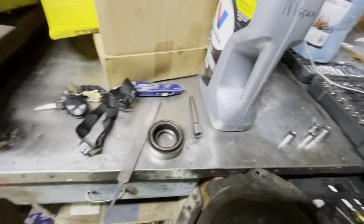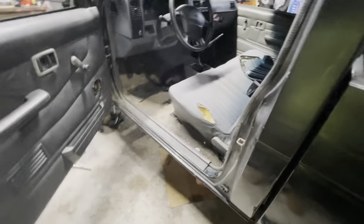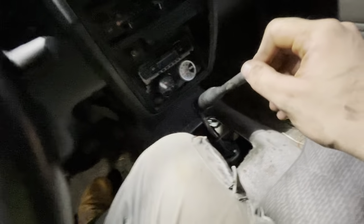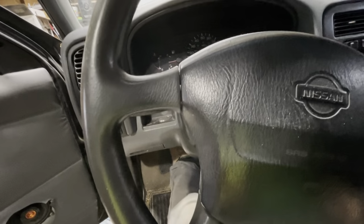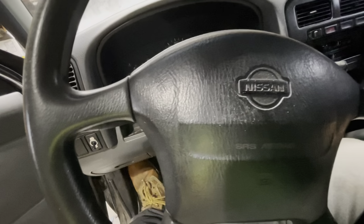And like I mentioned before, I put that new throw-out bearing in and it's a slightly different style. I was concerned that it may not actuate properly. So what we did is we got ourselves back together just a little bit. The shifter is just loosely mounted in here. First of all, with the slave cylinder hooked up, the new clutch feel is way firmer than before. So definitely stage two clutch pressure plate things.